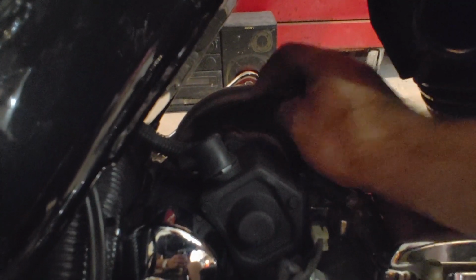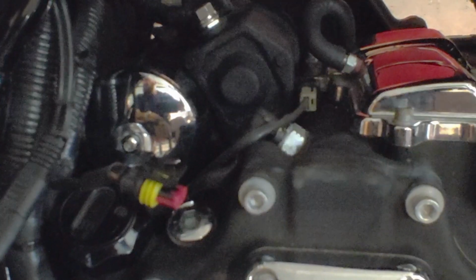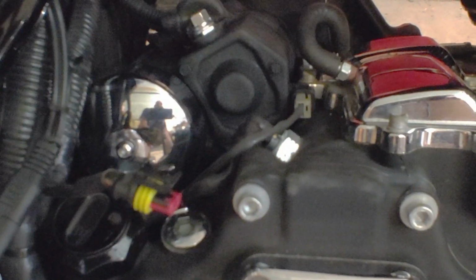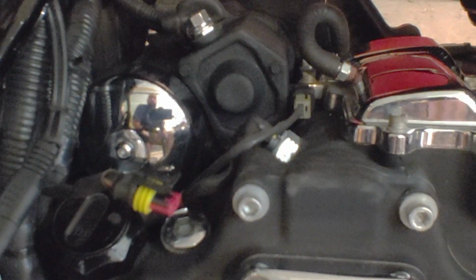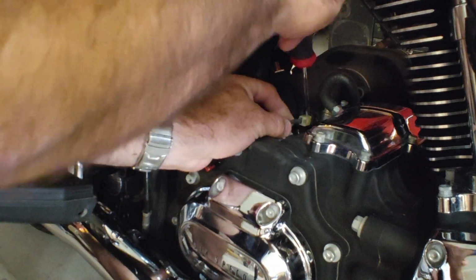Alright guys, so the bolt, I don't know if you can see it, is behind here. This was the bracket we had stuck in there. So let's undo this starter lead. It's the positive. And then we'll yank the starter out of there and see what we got. So moment of truth. Take that one last lead off there.